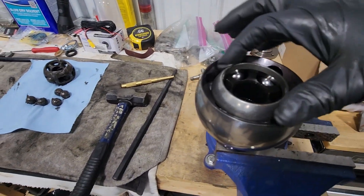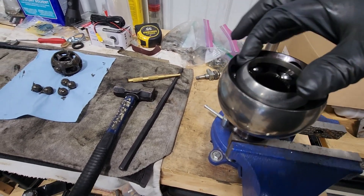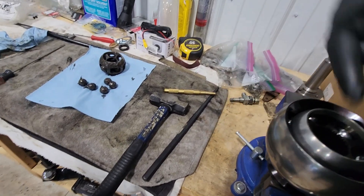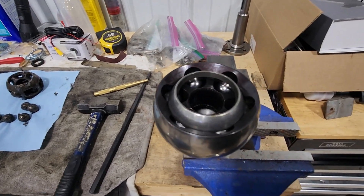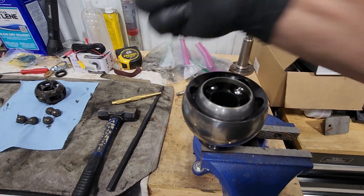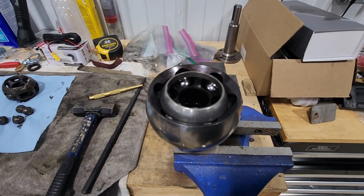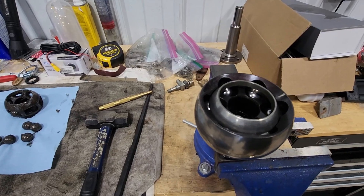What we'll do now is we'll grease it up — I'll get the moly grease, put grease in all around here, and shoot some in through the grease fitting so we can get some down inside the cage. Then we'll get the inner shaft back together, pop that in, move it back and forth to work the grease around in there. And then that will be it for rebuilding an RCV axle shaft.